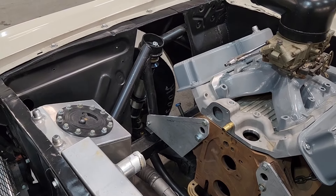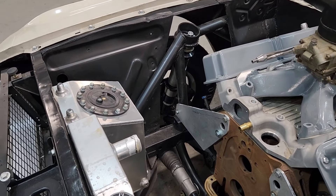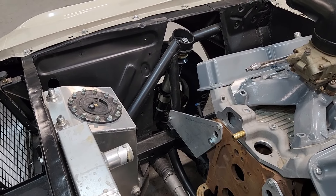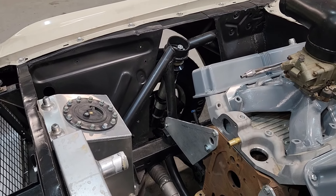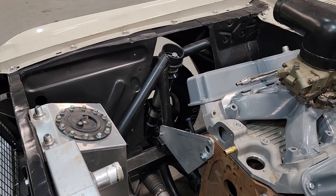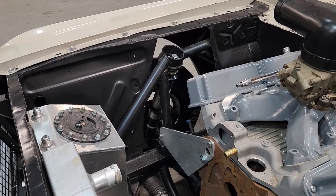If you're not familiar with the suspension under the front of the car, it's all based off of Fox Body Mustang parts. I used the Fox Body spindles and struts along with the upper mounts. It has Lincoln Mark 7 11-inch rotors, 5-lug. And I'll be using SVO calipers, which are 73 millimeter — a larger piston than the stock 5-liters have, even the V8 cars. So that'll help with braking power.